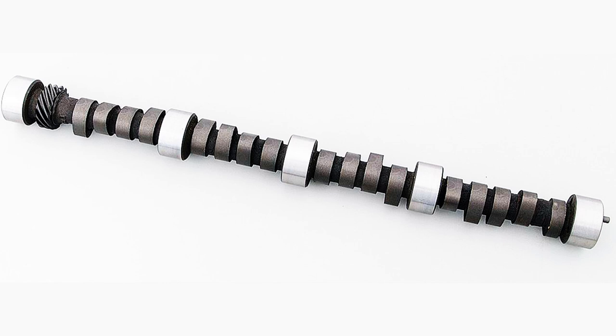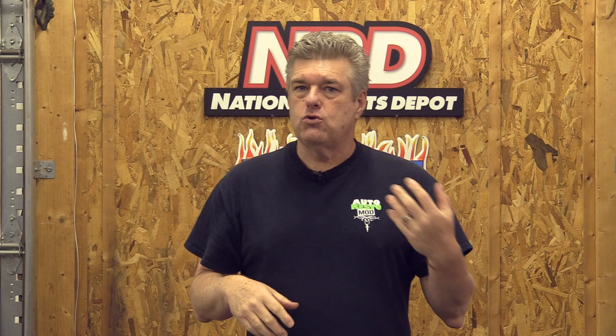Now we're going to get to the thing that everybody wants to know about — the camshaft. You're probably thinking they've got some crazy wild grind in there. The cam is the Leisure Suit Larry of cams because it is the Comp Cams High Energy 260H cam. It's a 260/260 on intake and exhaust advertised duration. Your lift is a straight pattern — 484 intake and 484 exhaust. Operating range on this cam is 1,200 RPM to 5,200 RPM.